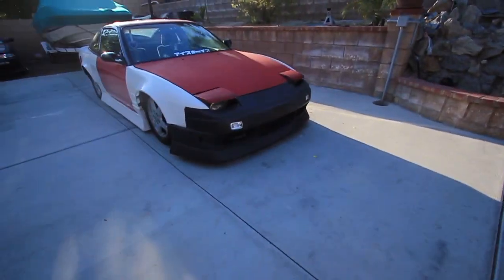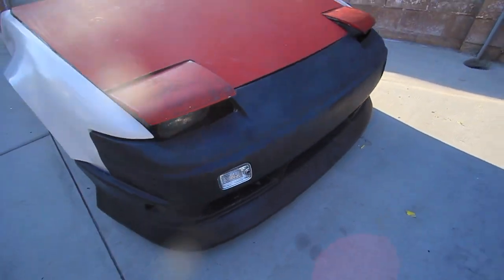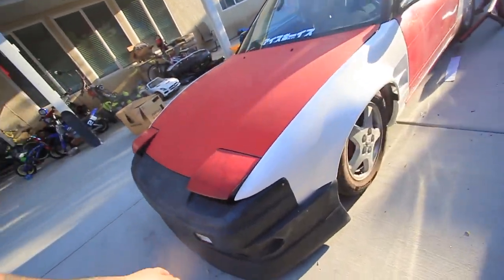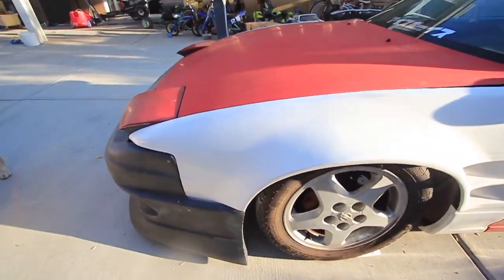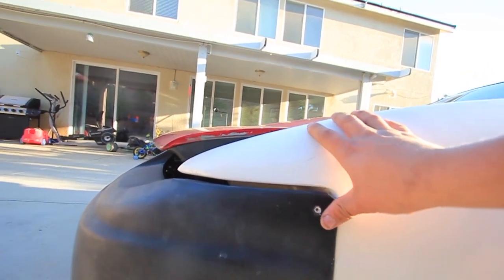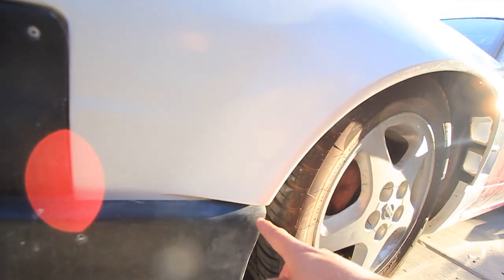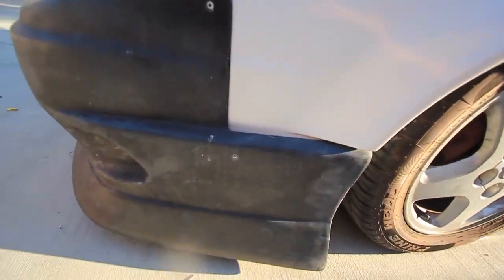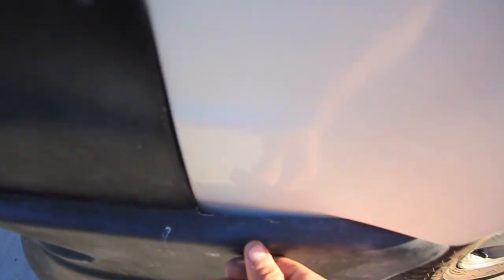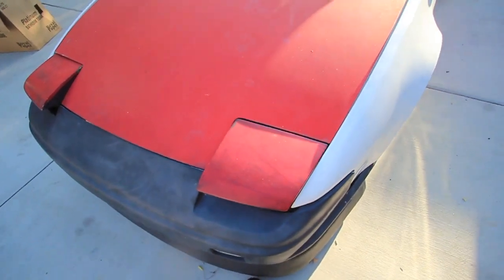So this is her S13 — I'll show you guys what I did to make it fit. We just got these corner lights, they're from FR Sport, I think they get them from Circuit Sport. I just wired one up yesterday to see how it fits. It's not the best but it's as good as possible — I've tried everything, including making a bracket, but the bumper just doesn't go any higher because it hits the over-fender. There's also a bracket inside holding the fender so it won't move, and the bumper is too stiff to go in line.